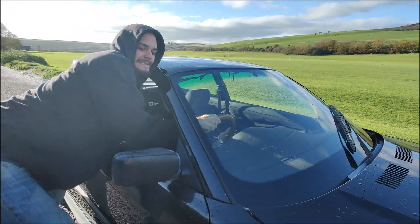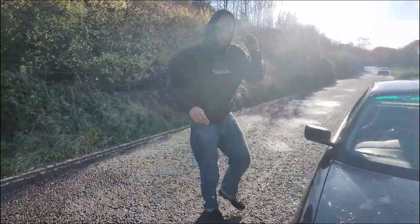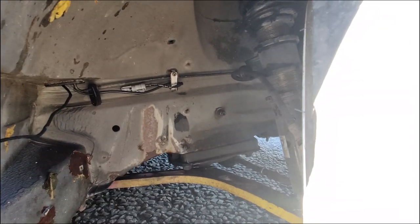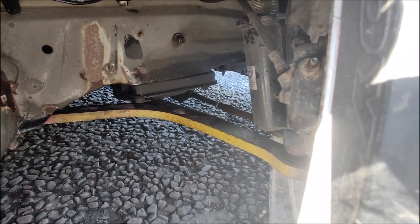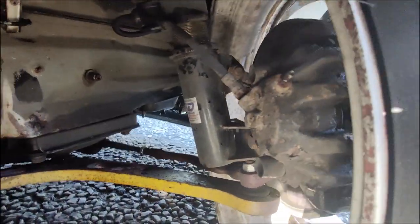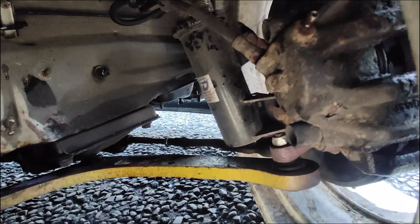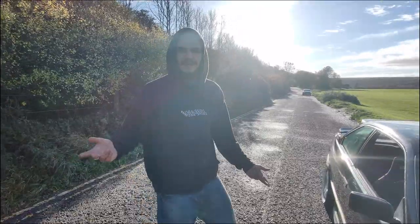Front suspension: looking through the wheel you can see the 50mm Wizard of Lock arms — that's the yellow thing. We also have CNC arms, E90 inner tie rods, E36 outer tie rods, HSD Dual Tech coilovers, Wizard of Lock cut hub, no ABS, no front anti-roll bar, and a stock subframe.